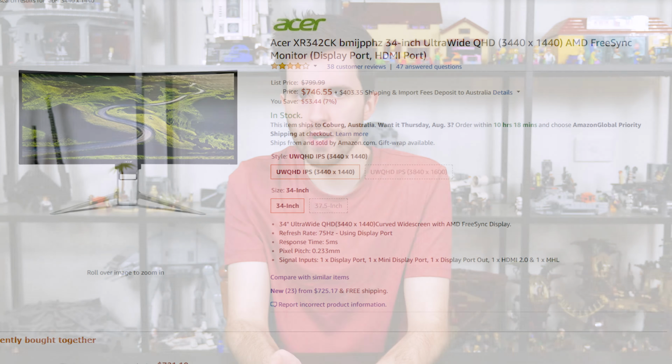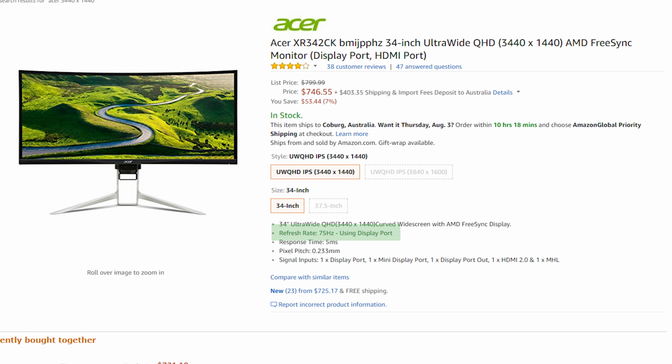Before I get into color performance, I did want to touch a little on the display's refresh rate and support for FreeSync. As I mentioned earlier, we're looking at a 48 to 100 Hz adaptive sync window, though the monitor does support LFC, so the variable refresh range is effectively from 0 to 100 Hz. This is important to note, as many other 1440p FreeSync ultrawides do not support LFC, as they have a more limited refresh window, more like 40 to 75 Hz.